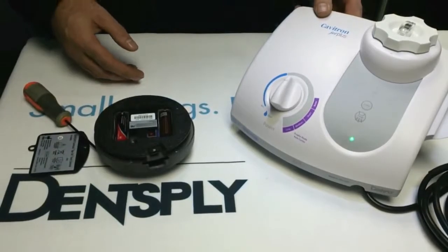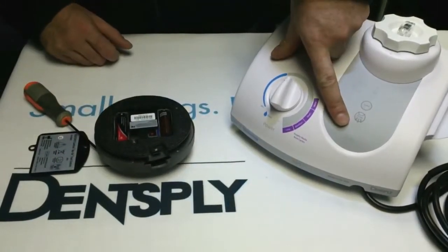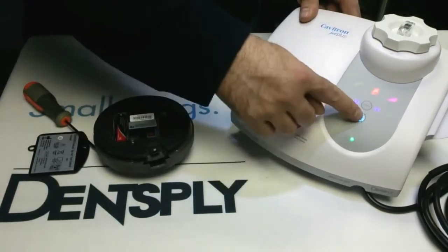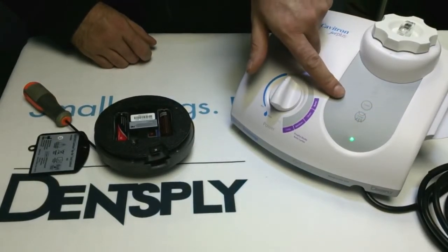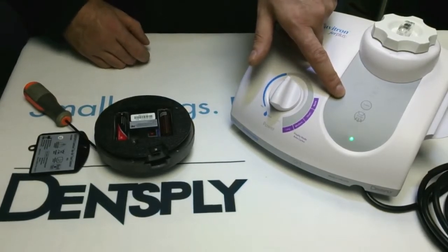The actual synchronisation process first of all involves turning off the machine and letting it power down until the power light is extinguished, then turning the unit on and immediately pressing and releasing the purge button. You'll see the lights on the display dance around as you can see here. Now to actually synchronise the footswitch you have to do it rather quickly — you only have about six seconds to actually synchronise the footswitch to the base unit.